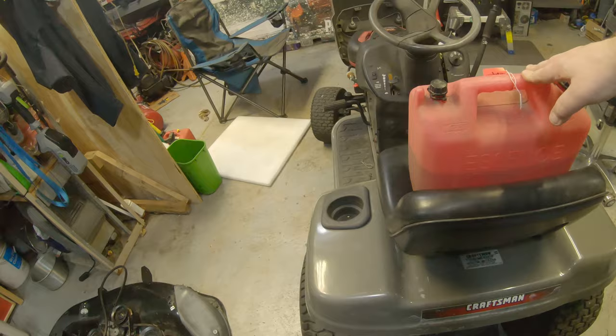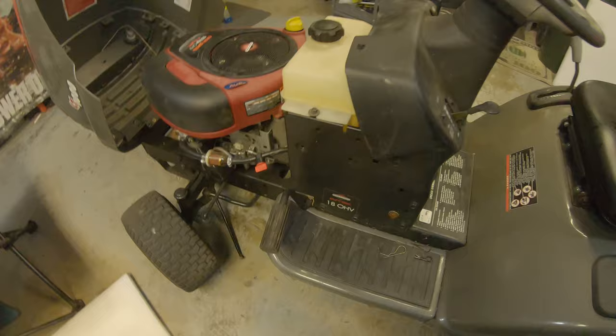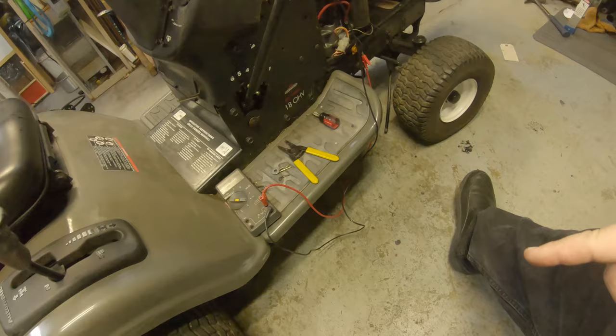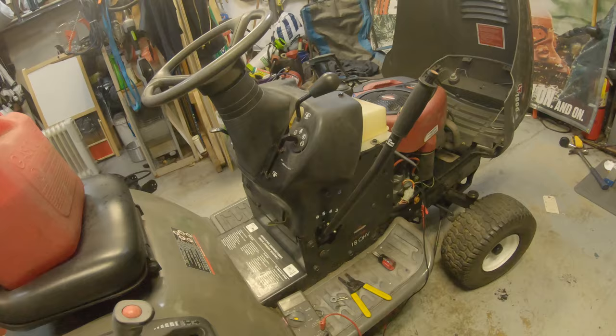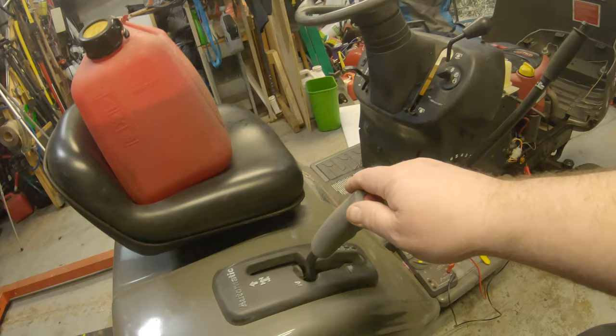What we're trying to do here is simulate the conditions where you would be cutting the grass. So our brake pedal is released, our seat switch is pressed down, and the blades are engaged. Even though I don't have a deck on here, these switches are all up here on top — it still does the same thing. So in this condition now, if you try to put this thing into reverse, it's going to shut the engine down — it's going to put continuity to that kill wire, and it's going to stop.